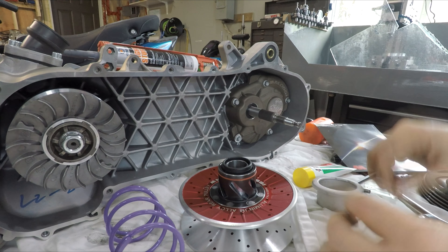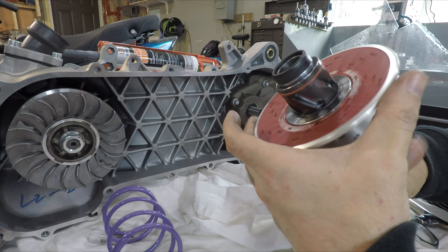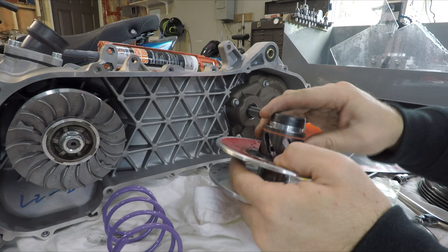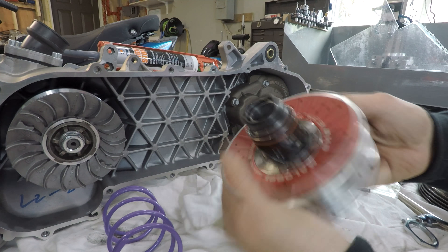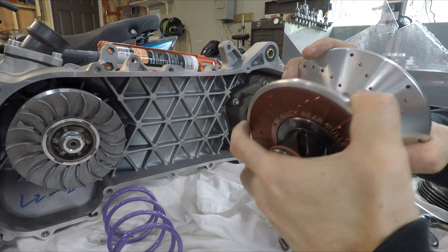There are a couple of shims for spacing out the bell if you need to. There are a couple different ramp angles - looks like there are three pin holes, and there's one with a dot on it, so let's start with that one. This is something you can play around with - changing these angles obviously gives you a different torque effect on the moving sheaves. Before I put those in I'm actually going to put some grease inside.